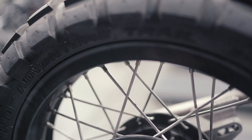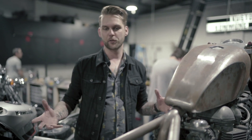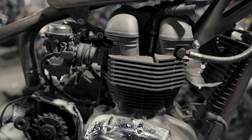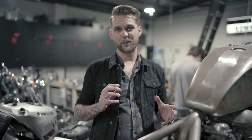We use a Cognito Moto wheel kit so we can get spoke wheels on these. Not only are we doing all the cosmetics and redesigning the frame, we're actually doing a lot of performance upgrades as well — HSR Mikuni carbs, a cam upgrade, and we're going to oversize the pistons too. This thing is going to absolutely haul ass and it's going to look pretty crazy.